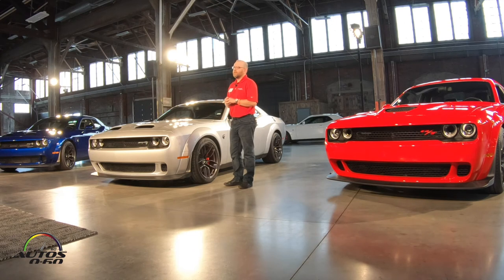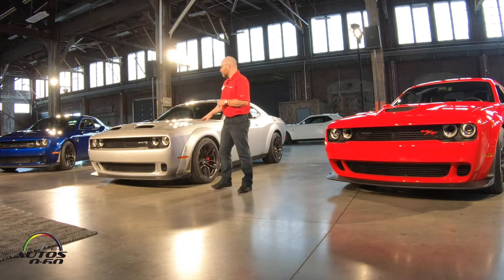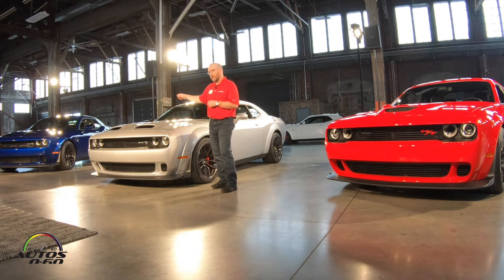This car has 90 more horsepower than a standard 2018 model year Hellcat — more straight-line speed on a racetrack means more heat into the brakes and quicker fade. So we added two brake ducts underneath the belly pan, which was required to meet our brake fade functional objectives. We picked up 33% more laps to fade — a big difference with a little bit of airflow. We then spread those ducts to the Hellcat Wide Body line as well for additional brake cooling.